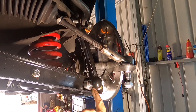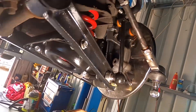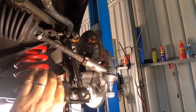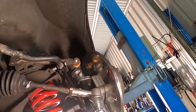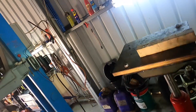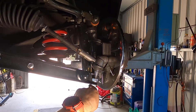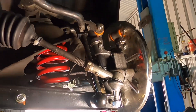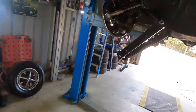This is one of the spacers I've had to make for the anti-roll bar, because the previous owner had just put a flat washer and a spring washer trying to make up the gap, then put two more washers and a spring washer on the back to try and make it work. I haven't got a nut on the bottom here yet — I've only just built it, so the steering arm is still to go on. The anti-roll bar is on again with no nuts on yet. I used a small piece of wood to get the bolt in between the disc guard where there wasn't much room — it went in okay. Just got to finish that off, and the other side will look very similar when it's done.